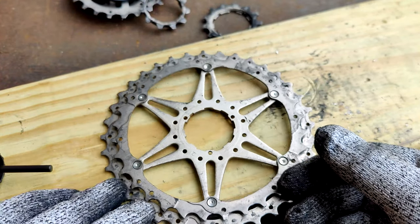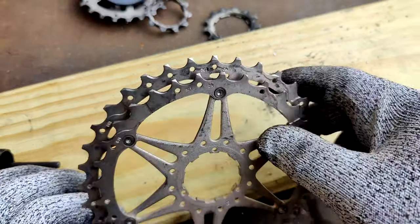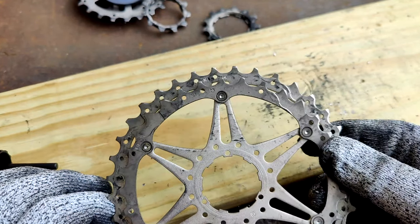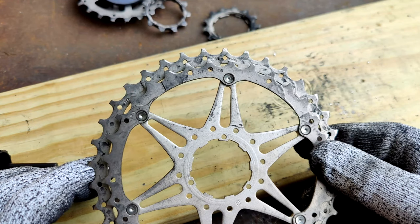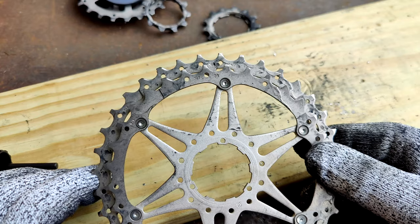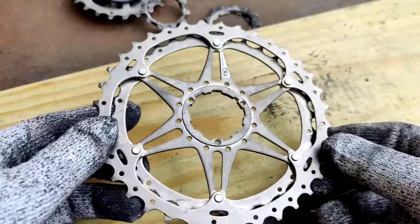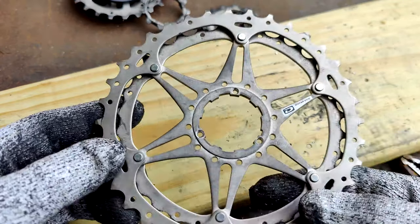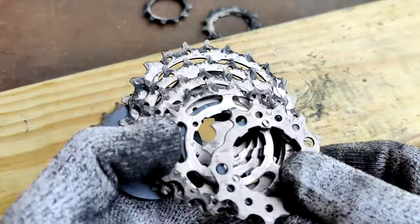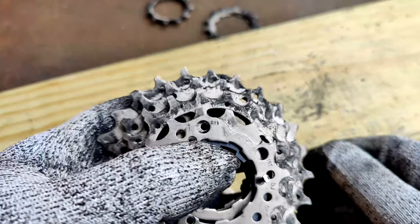This is part of the 72-volt upgrade I'm doing. Chances are I'll probably end up riding the 36 tooth — that was my original plan. Even though 42 to 36 seems like a very low gear, it'll easily do 45 miles an hour. I just want to make sure everything is nice and flat, which it looks like it is. If I can find a used steel cog, that's what I'll keep doing — just take out the pin, because I have absolutely no use for all this gearing with a 4000 watt motor. The chain will probably stretch easily over time under that stress.